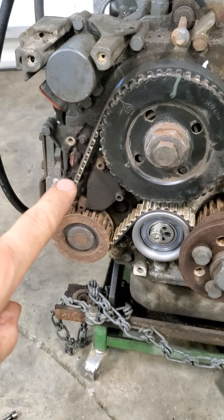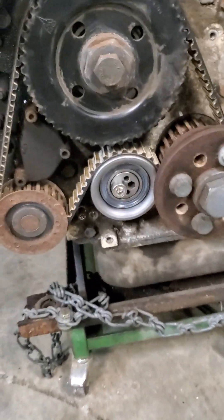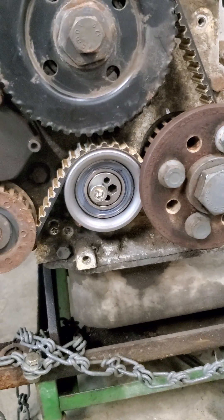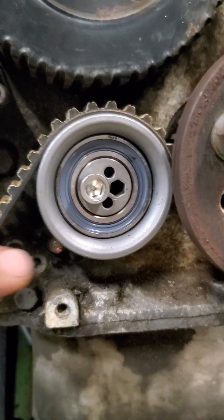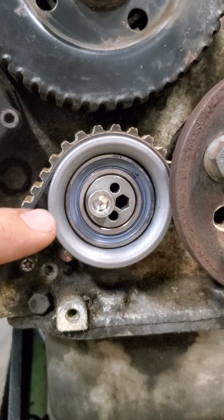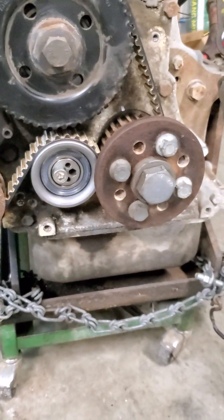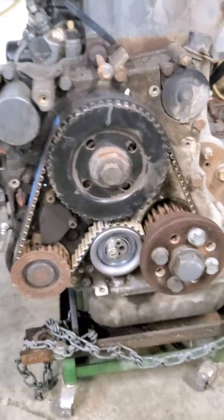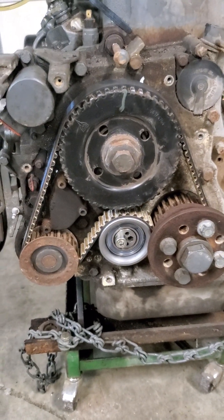On this side you'd normally use a belt tension tool, but for some reason on this engine something is sticking out and you can't get the belt tool on there, so I just eyeballed it. Also, the new idler pulley is installed this way - do not put it 180 degrees around because there's a bolt that sticks out and it will damage the pulley. There are quite a few videos on setting this part as well.